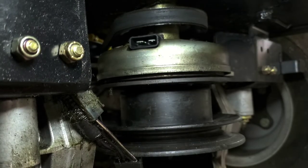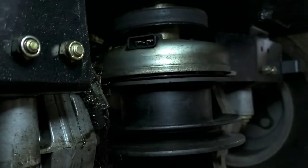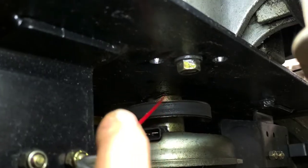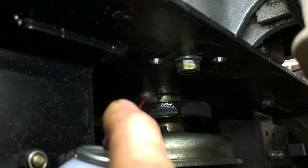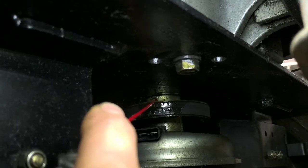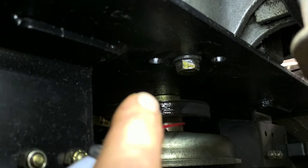And you're basically going to want to use a straw and get up to the highest point up top. So right up in here at the top, show you here, as high as you can get up. So right all along in there, you're going to want to spray that lube to get it up under the lip of that top pulley. So you spray all along up there. If you can access it from the top through the engine frame or anything like that, if you look down through and you can see the middle of the pulley, you can start up there also.